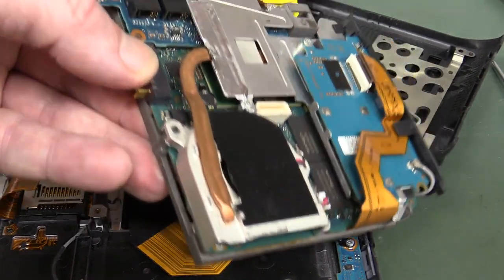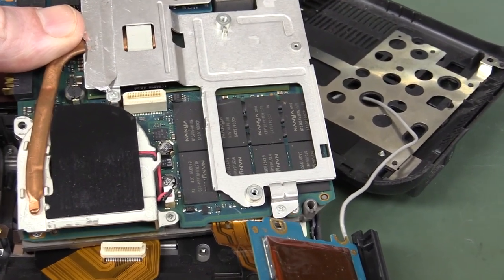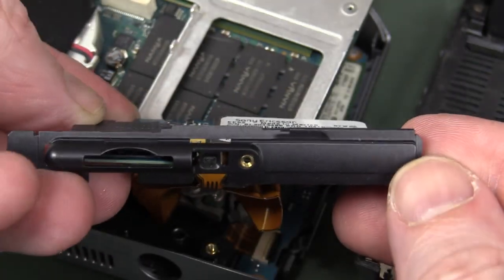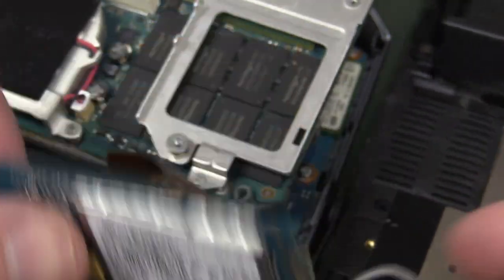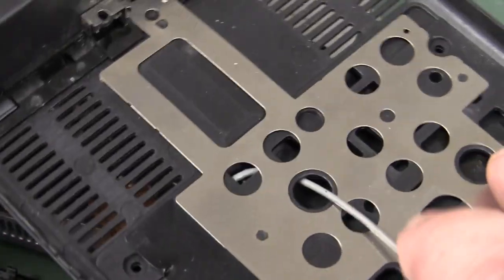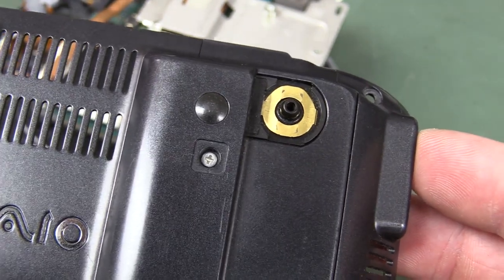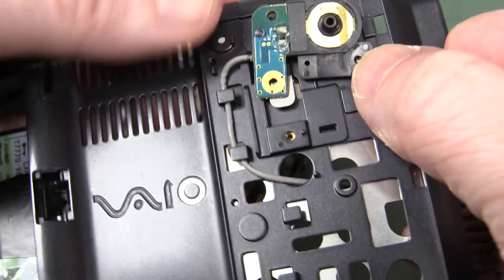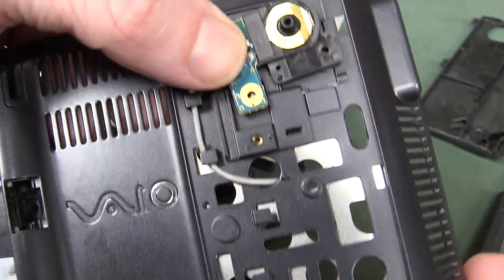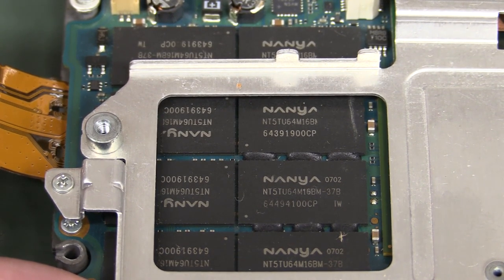If we flip this puppy up — there's all our memory. There's our GSM phone module, and there's our SIM socket right there. We've got a Sony Ericsson EE52 phone module. And I guess that answered the question — that's the GSM antenna right in there. And it looks like they had an external GSM antenna connector there. So that coax is just going up to that external connector. And you can go decode those DRAM numbers if you want, but I believe this model was one gig — just enough to run Windows XP on a device like this.